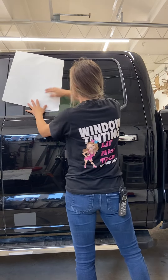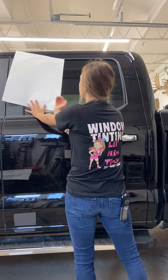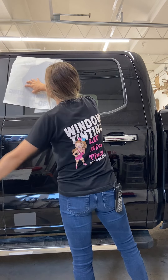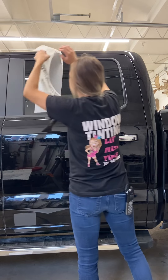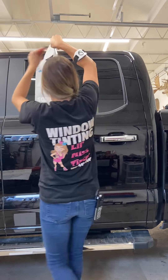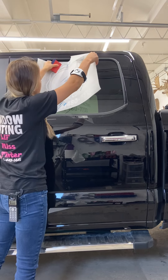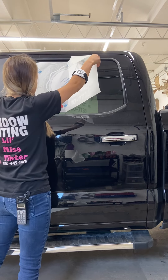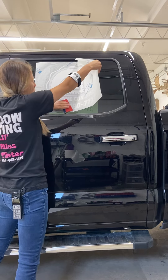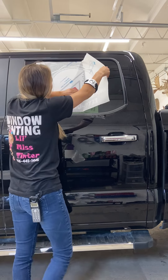I'm going to pull the backing — this is where it did pop out for me, but if it had been really crooked it would stick underneath there and be really hard to get out. I'm going to peel the rest of that off and hold it out so it doesn't touch the window before I get there with my squeegee. Always keep your squeegee line as a smile line. If you're not comfortable going up and down you can just go one way — whichever is easier to avoid wrinkles.